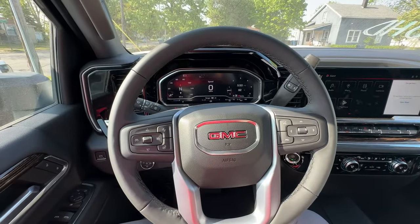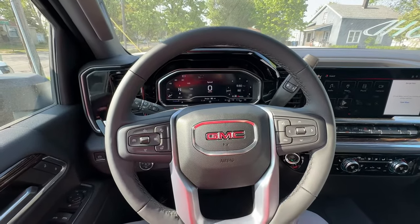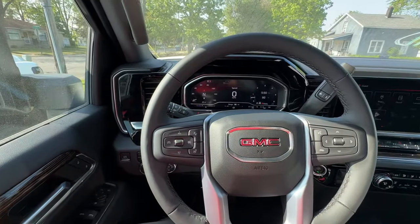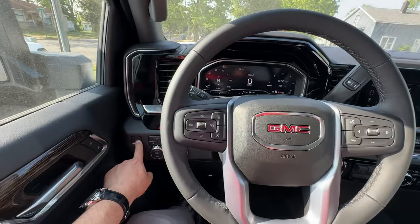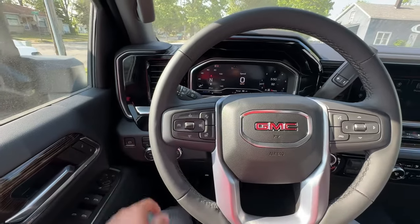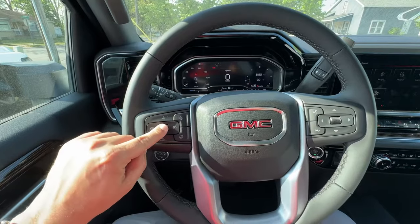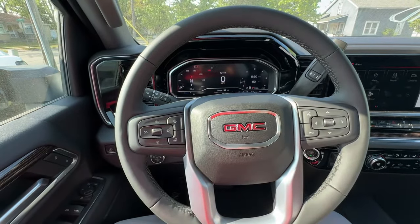There are two different ways you can do it. I'm here in the hot summer right now so it's not going to activate when I perform it manually, just because there's no use for it. First thing you're going to do is put on the parking brake. Second thing is just roll down your cruise control to the set, and that will bump you up to the elevated idle.